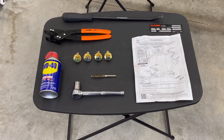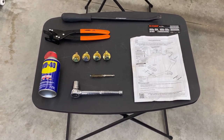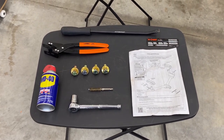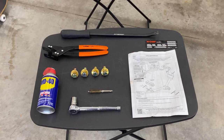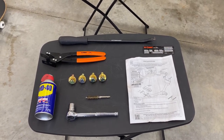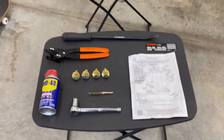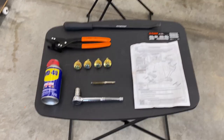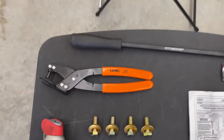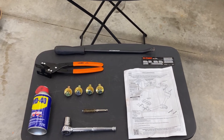Installing the hitch should be pretty straightforward since there's already bolt holes in the frame that we can use to bolt onto. Here's about everything we're going to need. I'm going to use a wire brush as well as some WD-40 to clean out the threads for the bolts, and then I'm going to use the 19mm ratchet and socket for the bolts. The trickiest part of all is getting the exhaust off of the rubber hanger, which they recommend using a long crowbar or something like that. I actually went out and bought the proper exhaust pliers, and we're going to see how those work out. Links to all of this stuff — the exhaust pliers and the hitch — will be down below as well.